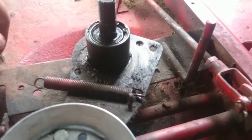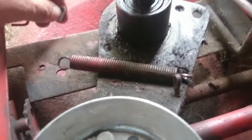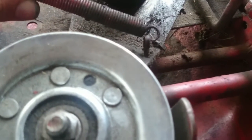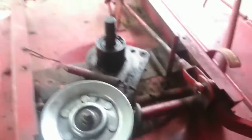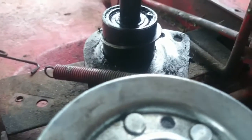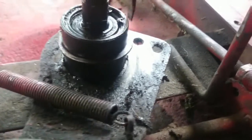I've got my snap ring in. Make sure you get it in the lower groove - there's an upper groove and a lower groove. Now my pulley assembly can go back on. It faces towards the back, just like that. That spring goes here, the band brake goes around, and I have to put the pin back in for it. That spring goes into that cotter pin right there. Now I've got my second snap ring started - I'm going to tap the thing down with the hammer until it hits. I'll need two hands to do this.